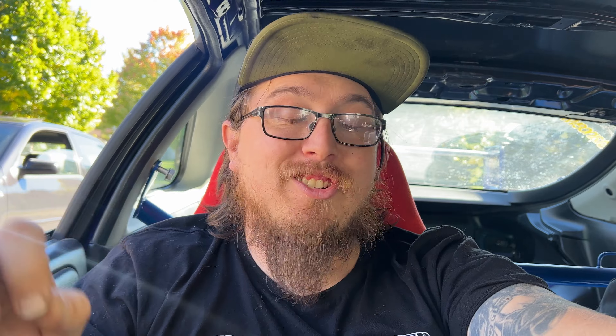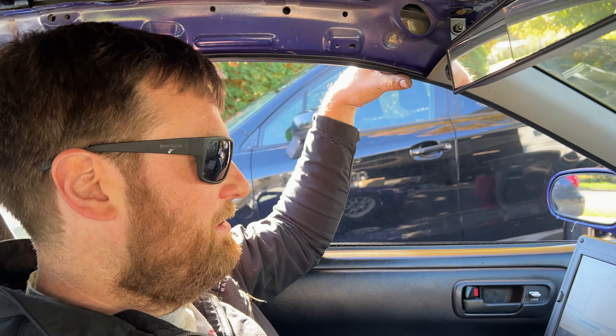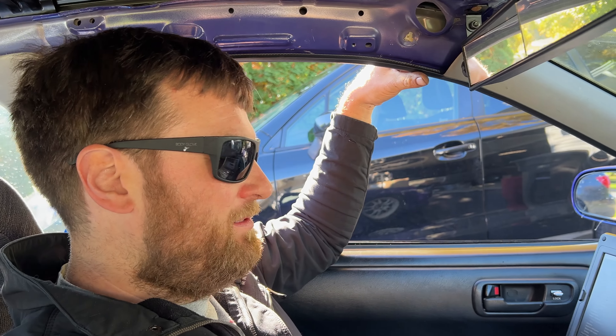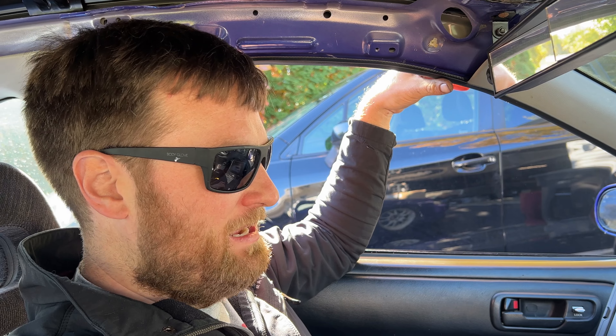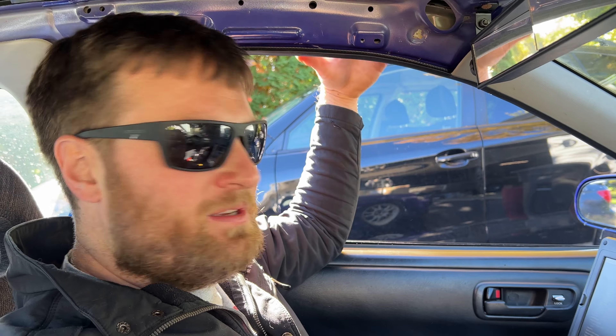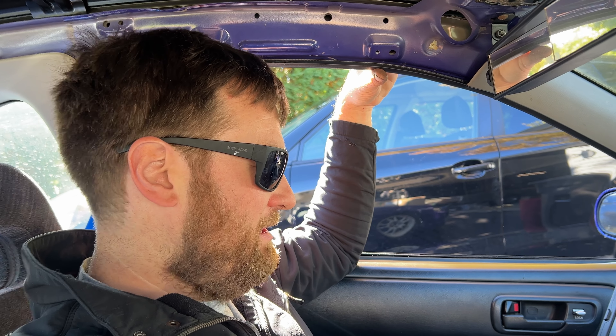It's loading up pretty good at really light engine loads. Actually no — it's lean, that's what's causing it. It's lean when you open up the throttle a little bit. It makes sense because that snap opens up a lot more air than the engine was using. It needs more fuel down there. But we have it — it runs and drives.